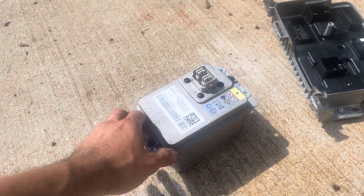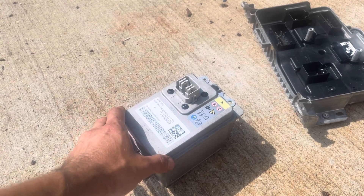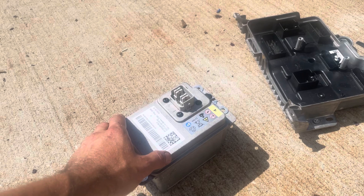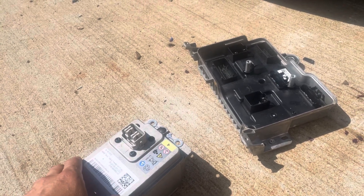If you bought a new battery and it drained to low voltage, it's not going to drain to a low enough value where the car will not recognize it. The car will recognize it and will start recharging it if you do a software update and if the contactors closed and the post-crash load shed is cleared on the VC front.